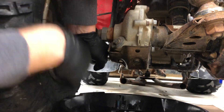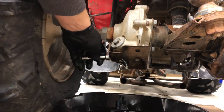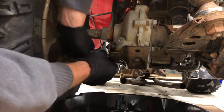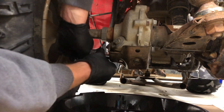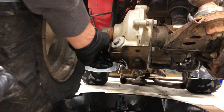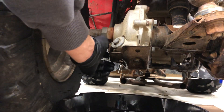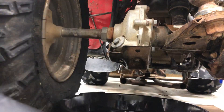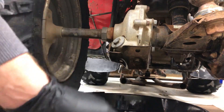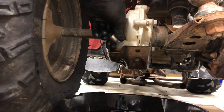Go ahead and pull that bolt out. I've got my drip pan already below it — these don't hold a lot of oil. Now that we've got that 10 millimeter bolt out, go ahead and get that to release. It is a little cold. It's filling up the drip tray here with some oil before it'll go down into that pan. Now you can see it's starting to flow.